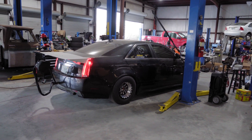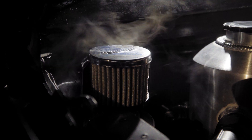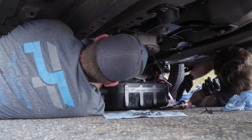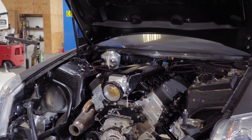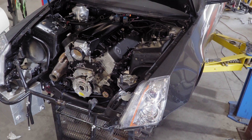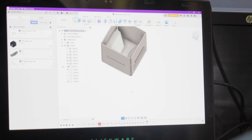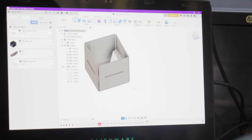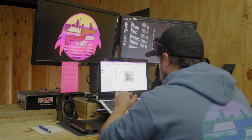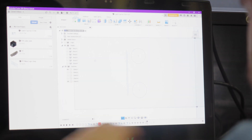This week's mission is to design and build a catch can for the back of the CTSV. In the last event, we were using kind of a ghetto setup — basically a pail with a smaller pail on the inside, a bunch of holes poked in it, just to alleviate pressure from the valve covers and the crankcase. Because we're pushing a lot of pressure through all that stuff, running meth and running the boost levels and the compression ratios we are. Step one is designing it up in our CAD software. I like to use Fusion 360 because I can fold it up in the sheet metal mode to actually see where everything mates up. You lose material when you do a bend — it makes it a little wider than your original measurements. It's easier to visualize, so I like to use that program to see physically what it's going to look like after I make each of the pieces in sketch mode.